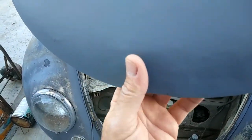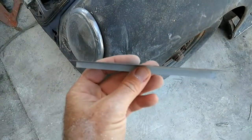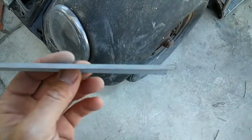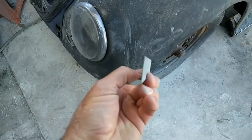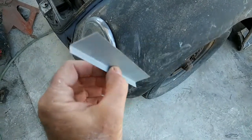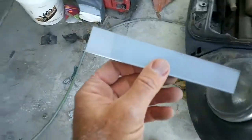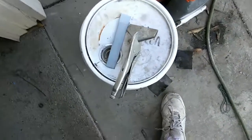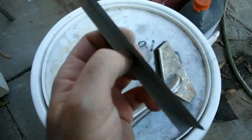So what I'm going to do is show you guys what pie cutting is, a couple of different ways to pie cut, and how to fix this crack. I cheat a little — I have a metal brake, so it's a lot easier for me. I'll also show you a way you can do this at home. You make a piece of metal like this — notice it has no angles, just straight and bent.